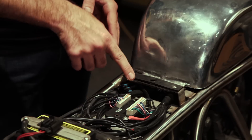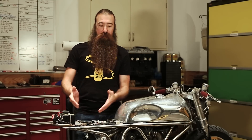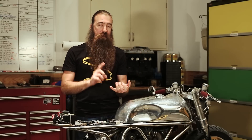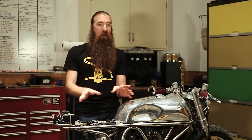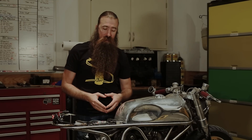Basically all you need to do is send a ground reference pulse to the auxiliary 2 input — one pulse per wheel revolution or some consistent number of pulses per wheel revolution. Once you have that wired in, you ride at exactly 50 kilometers per hour and triple-click the horn button three times while riding. That initiates the speed and mileage calibration of the M Unit Blue — the turn signal will flash for 10 seconds during which you maintain exactly that speed. Once complete, the unit knows how fast you're going, tracks total mileage, and can send alerts to the app: for example, 'It's 3,000 miles — time for an oil change,' or 'It's been 15,000 miles — check your brake pads.'